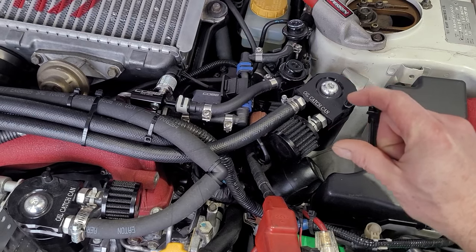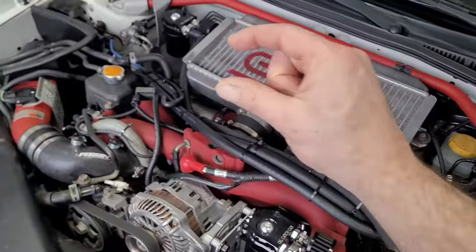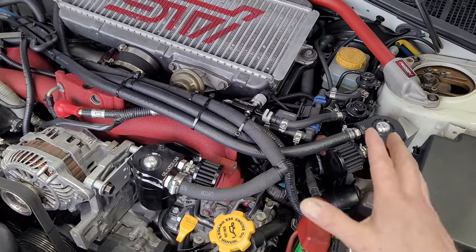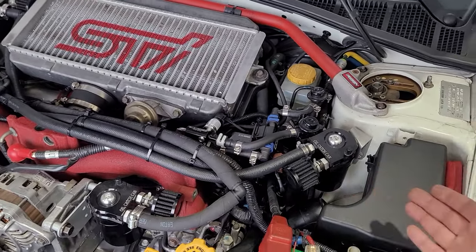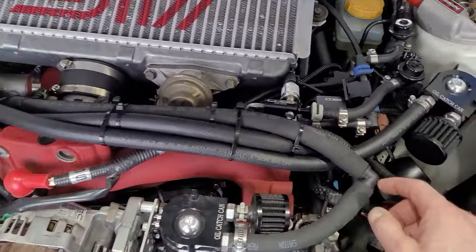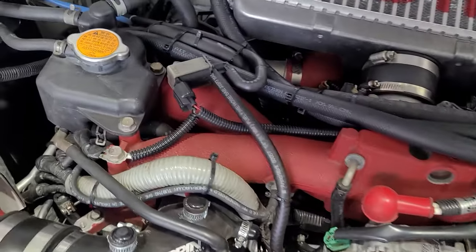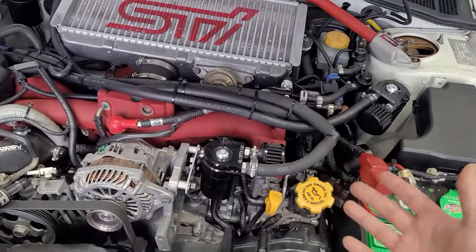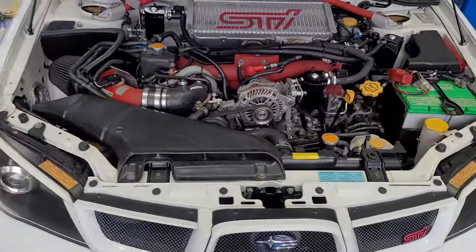It did fill up, but not quick. It took three sessions - maybe one hour of on-the-limit driving - and the catch can collected about this much oil. The block about the same, maybe this much. For some reason this catch can fills up quicker but it's much much slower overall. So this worked. This was essentially a $15 fix - just some oil-resistant hoses. Don't use coolant hoses - get oil-resistant or transmission hose. Cheap solution: just flip the catch cans around. Problem solved, instead of buying fancy $300-400 check valves.